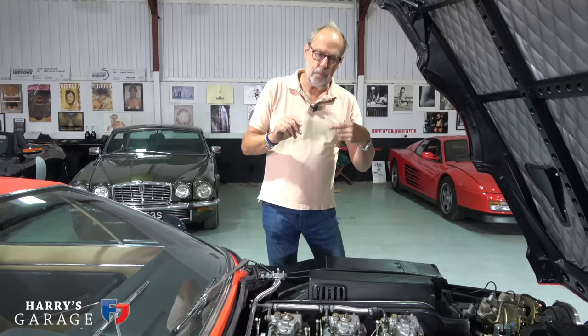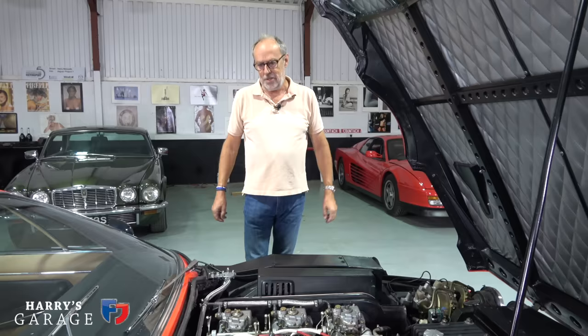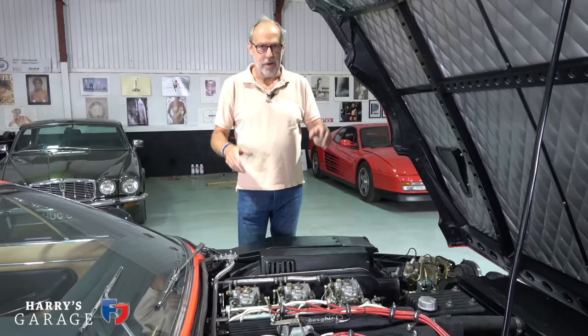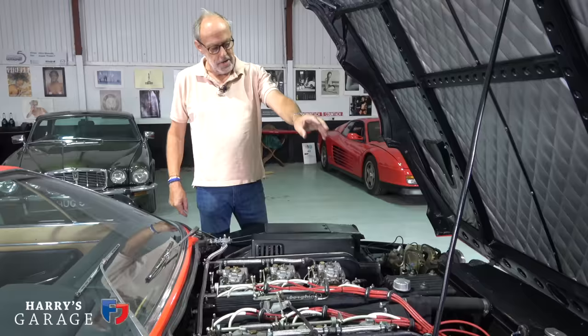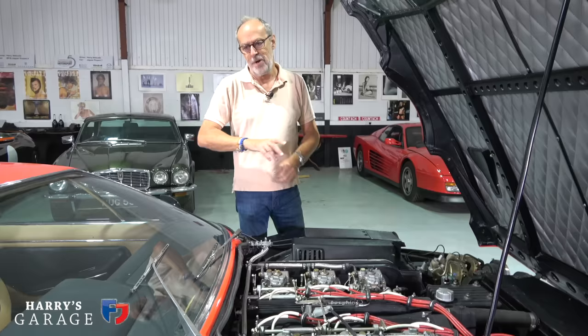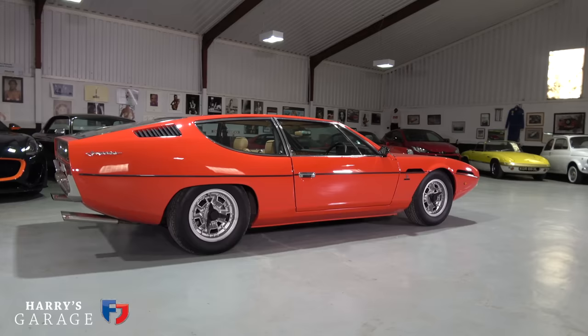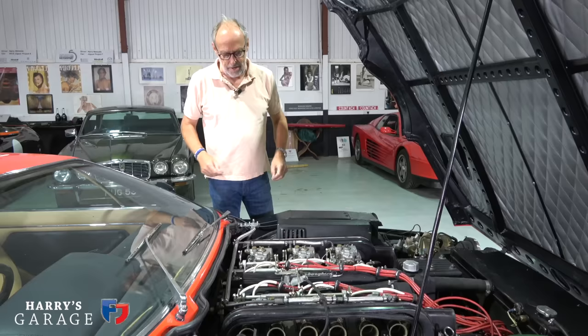What they discovered was that I'd fitted electronic ignition, which wasn't giving a clean firing signal - there were a few pops, bangs and slight misfires, which is bizarre because you fit electronic ignition to avoid that. The car has a points system as standard and it never did this before the rebuild. They went back to a standard distributor but performance was still lacking. The distributor didn't actually have any advance on it - as revs rise, the distributor weights should add advance, sparking earlier as the pistons come up. It wasn't doing that. Now it's running a standard points system with a rebuilt distributor that has advance, and I now have a singing V12.